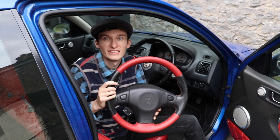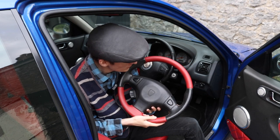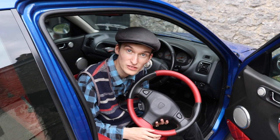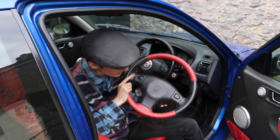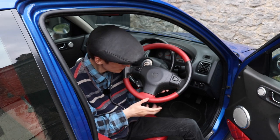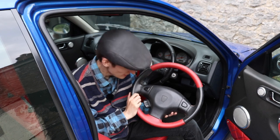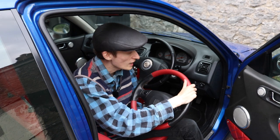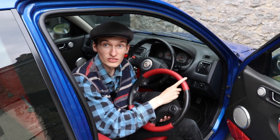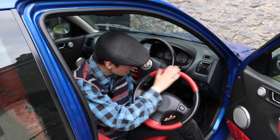And now this is a genuine Rover 200 BRM steering wheel, what we rescued with the interior that rainy day in Newcastle last year. I got a dye kit off eBay and dyed it, and then sealed it to make it red, because the problem with these steering wheels is they go black when they wear, and there's one in the other car, it's starting to wear. We might actually have to refurb that one at some point, but this one's nicely done.